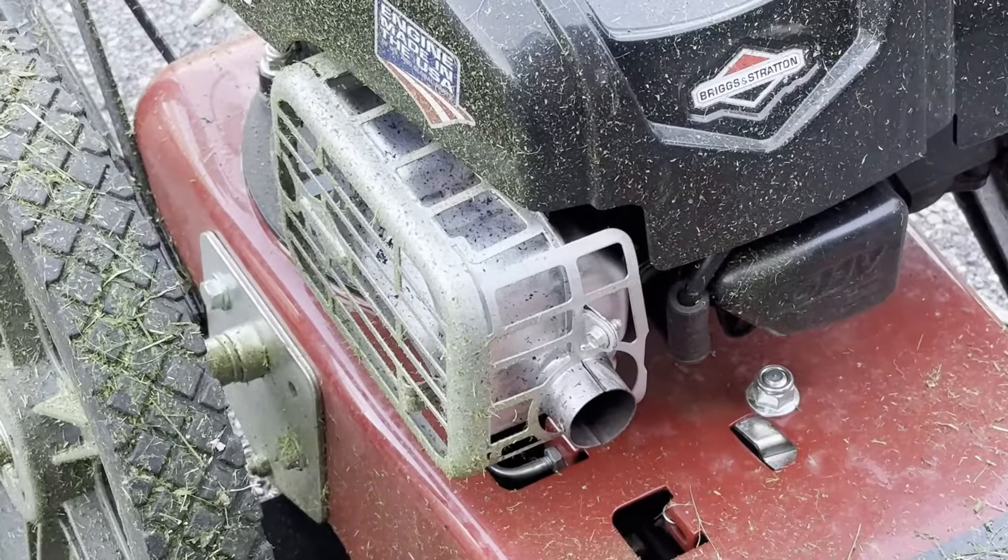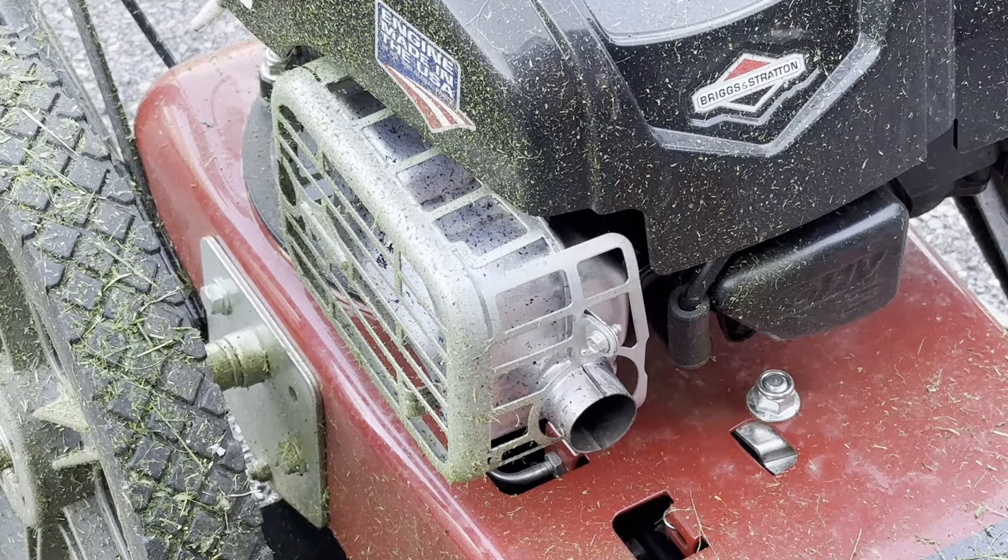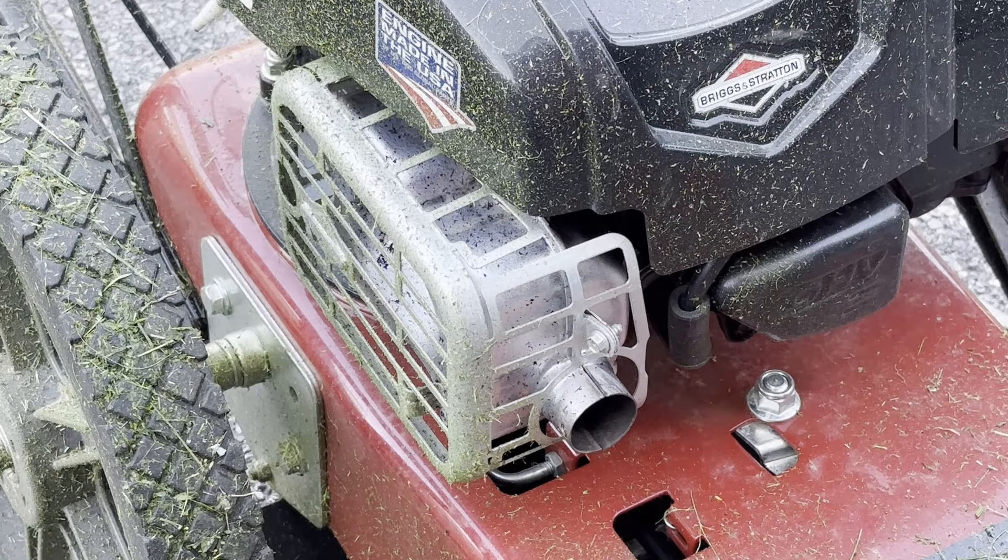First thing here is right at the exhaust. This had a spark arrestor on it which had carboned up quite a bit. Where I live it's wet all the time — there's one part of the year where it might get dry, at the end of winter. Just to make sure the engine is performing well, and I don't really need the spark arrestor here, I went ahead and took it off and put it to the side. For those of you living out west, that might be more of a concern — you'd definitely want to keep it on. It's easy to decarbonize those; it's just another maintenance thing.